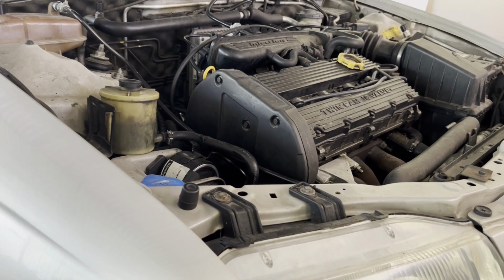I could maybe tear it apart and just take care of that, but this is also due a timing belt. That's also a job that I have to do. And I don't know for how long the head gasket will go. When I replaced the sump, I've noticed that there were some cracks in the oil rail, and that's how they sometimes go, because when they crack, then the bolts cannot maintain the tension that they had. And eventually you have a head gasket that moves ever so slightly.